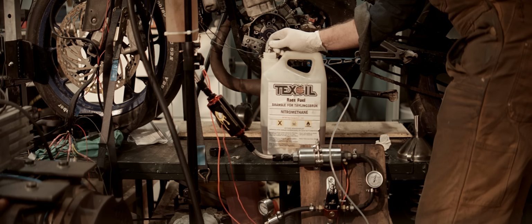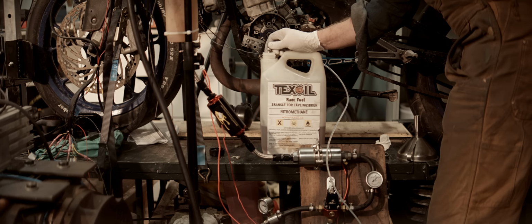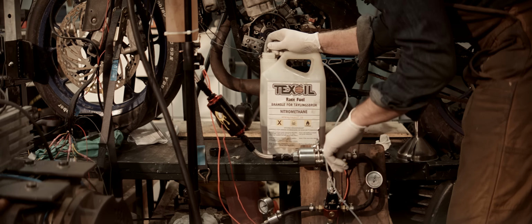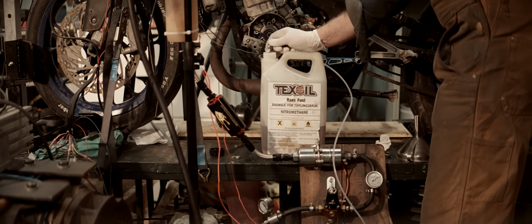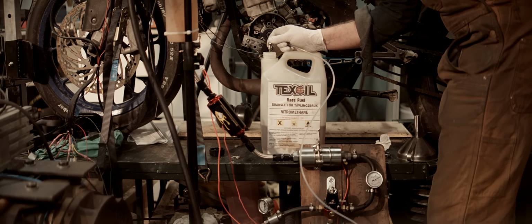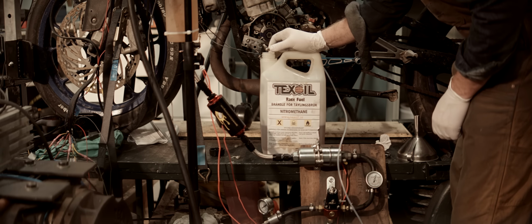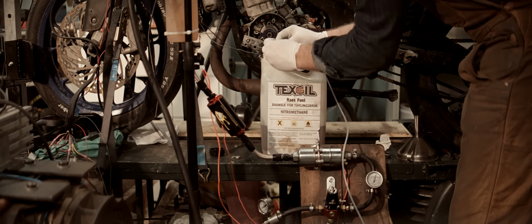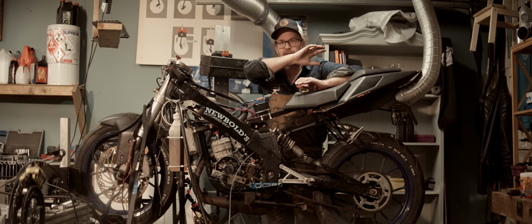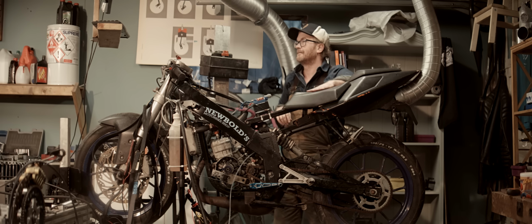Now it's only returning. Nothing but returning still. Hopefully the jet isn't clogged. There's something wrong with my jet, because it's not supposed to squirt out the side there, so probably some dirt in there, but you know what? Let's try this. Let's try it like it is now. And we can first of all clean the jet after our initial testing and make it work as it's supposed to work again. I have a strong suspicion this filter is our problem, that we can't have a filter on the inlet. I'll get exhaust extraction and stuff going, and we'll start it up on gas, warm it up a little bit, and then see what happens with nitro injection.